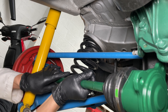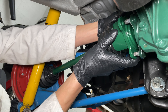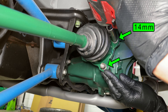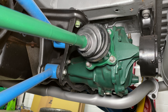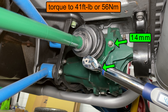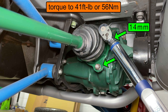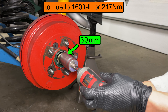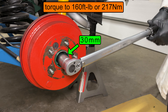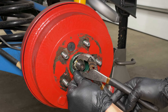To install the rear axles, slide the splined end into the hub first, then compress the inner CV joint by pushing it toward the outside of the car. It will barely slide past the studs on the differential. The inner CV axle flange is held on by four nuts and four lock washers. Engage the parking brake and spin the nuts on, but don't tighten them yet. Release the parking brake and turn the axle so you can reach the other two studs — install the nuts and washers. Torque these nuts to 41 ft-lbs. Release the parking brake and turn the axle again to reach the other two nuts, engage the brake, and torque the other two. Install the axle nut — torque it to 160 ft-lbs. Install the axle nut cover and a cotter pin; this will prevent the nut from spinning off if it gets loose. Squeeze the cotter pin down to prevent rattling.